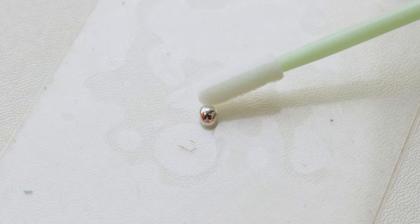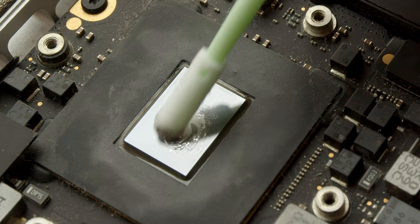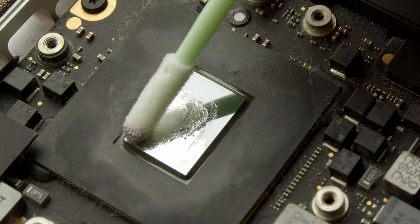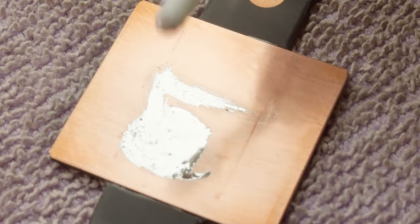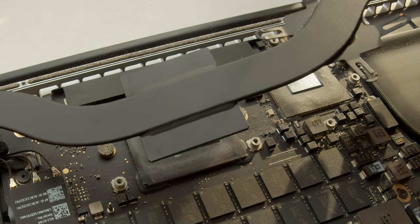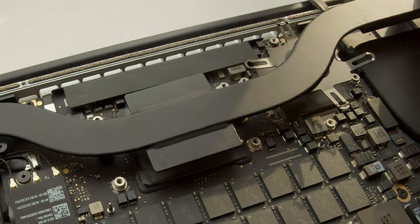As we know, the surface tension of liquid metal is pretty high. It means that if we apply a very thin layer — as thin as is even possible — to some flat surface like a CPU die, liquid metal is just not going anywhere. Then if we apply a thin layer to the heatsink as well, it's also not going anywhere thanks to surface tension. After that we place the heatsink right where it belongs, and two thin layers of liquid metal embrace each other and happily bond together, meaning they're absolutely not going anywhere no matter how bad you shake your computer.